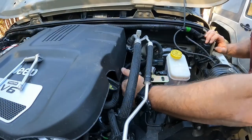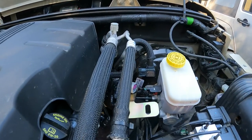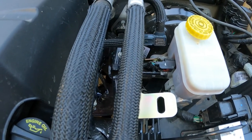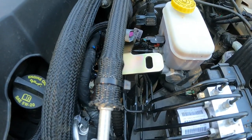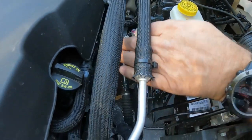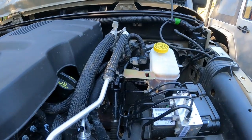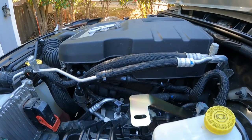What we did is unbolt the lower bracket from the main plate — it's just easier to get it hooked up in there. Per the instructions, we're making it work. That lower bracket is now unbolted and we'll mount it on the bottom at the master cylinder bolt, then go ahead and mount the plate on top. It's kind of hard to get down in there, but that lower bracket is mounted.